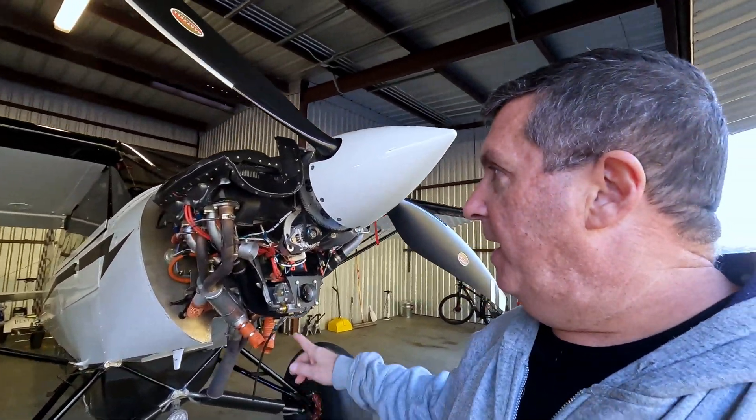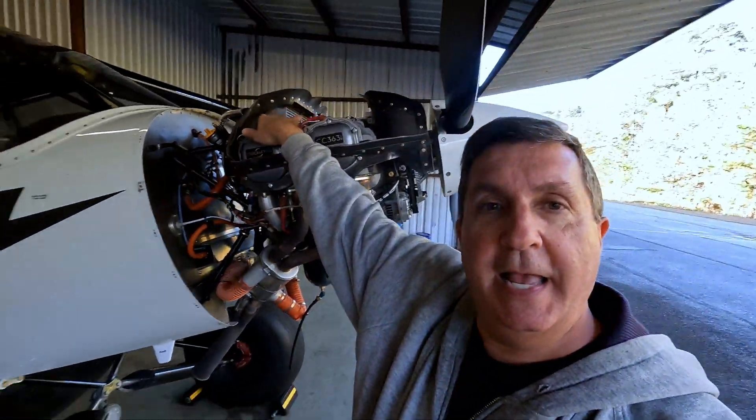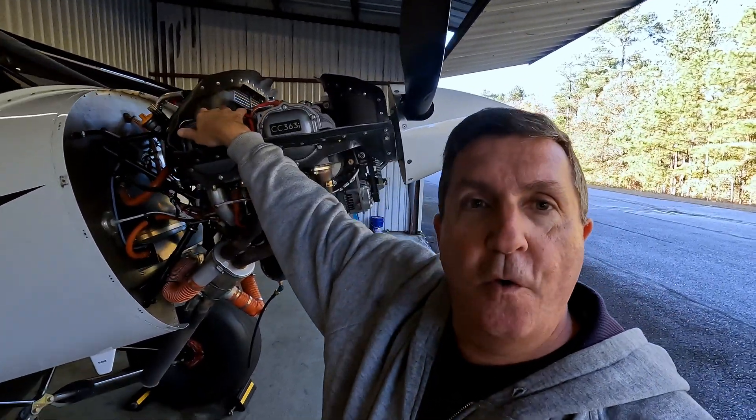What else can cause a coil pack failure? As I've learned in this process: if during your condition inspection your A&P pulls your plugs, checks compressions, and doesn't get the connector seated properly, per Klaus it can cause arcing and short out your coil pack. Would this have happened on multiple cylinders? I doubt it. Multiple people including John and Pete are reporting the same erratic RPM issue — so it sounds like there's a quality issue with the coil packs.